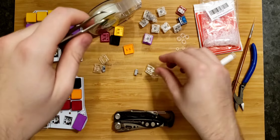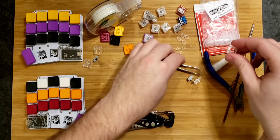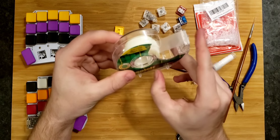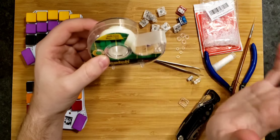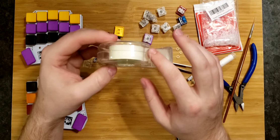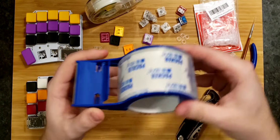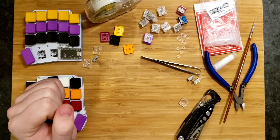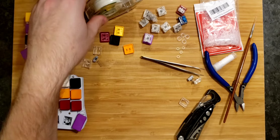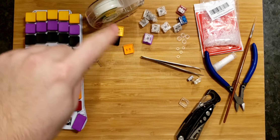As mentioned, you've got four components. We're going to need the top housing to do the tape mod. In terms of the tape I use, I just use Scotch tape — specifically one-sided magic tape. The important thing is that it's thin, sticky on one side, and smooth on the other. Some people, specifically Germ from G-Heavy Industries, recommend packing tape. I like Scotch tape because it has a weaker adhesive, which helps with accuracy when tape modding.